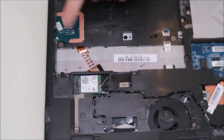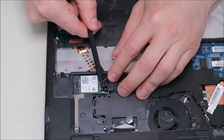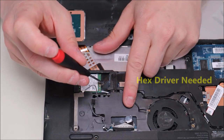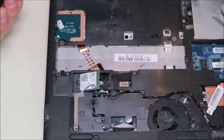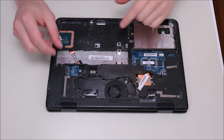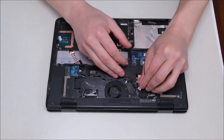To remove your Wi-Fi card — this is pretty standard — the Wi-Fi card is held in by one screw and two antenna wires. We're going to take our plastic pry tool and pop up the antenna wires; they come up fairly easily. The screw is actually a hex screw, so you may have trouble getting it out with the same screwdriver you used earlier. Once the hex screw is out, the Wi-Fi card will just pop up and then you slide it out. To continue further into the computer, you have to take your antenna wires and run those out of their channels.